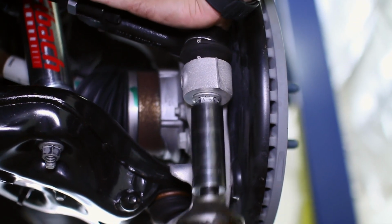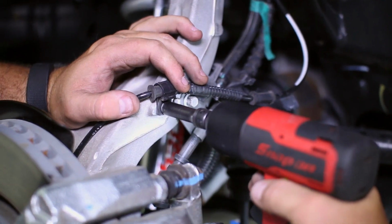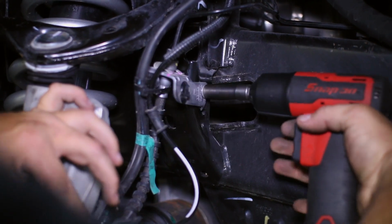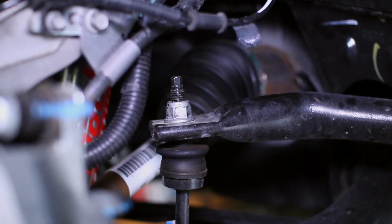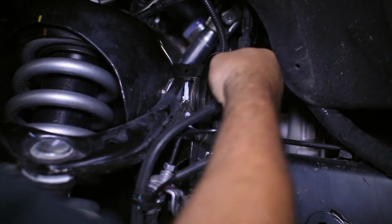Moving our way over to the brake lines, they can all be replaced into the knuckle as well as the bracket up in the frame. Tighten the sway bar back to the end link, then you can finish up the install by clipping in all of the wire looms to the frame and the dust cover back on top of the wheel well.